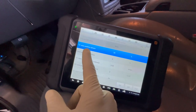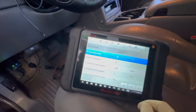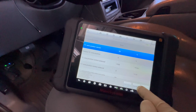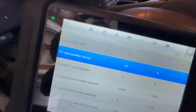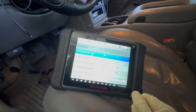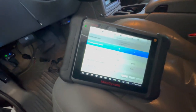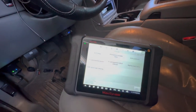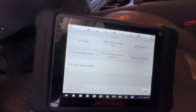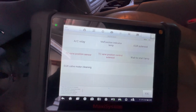You can watch the sensor position and it should match your vane position sensor to the desired TC vane position. Going back to the TC position sensor test, this is a little more precise — you can go up five percent at a time. I recommend going all the way open and all the way closed, listening for the turbo noise to change, and watching the sensor data to make sure it doesn't drop out or do anything that doesn't look right. These two tests will help you determine if it's either a bad sensor or solenoid, along with visual inspection.